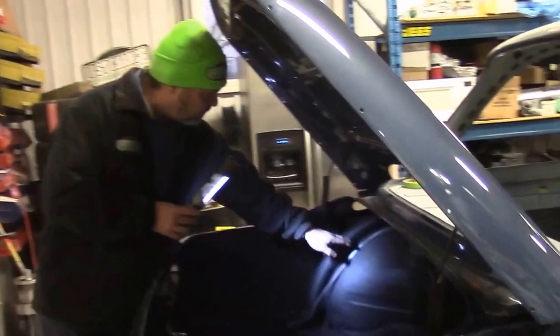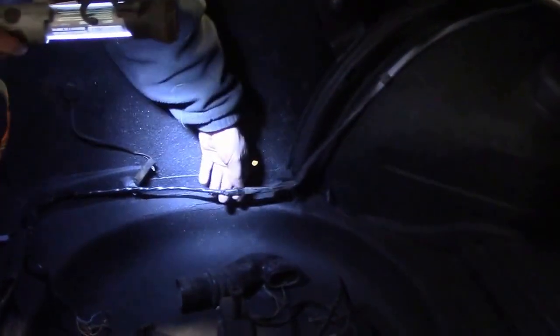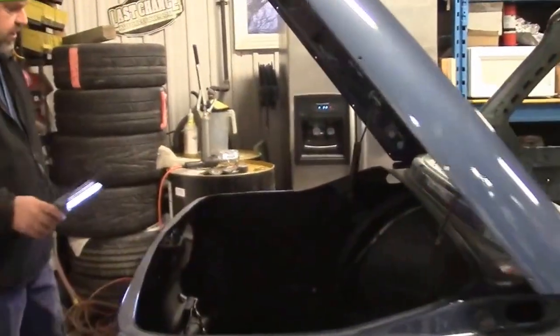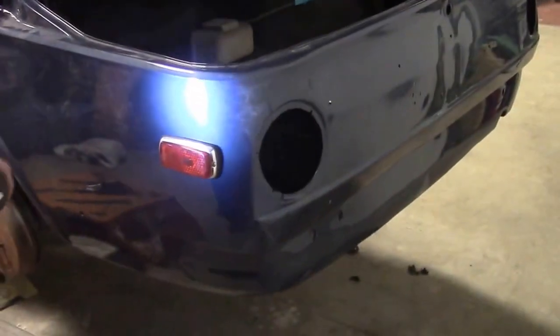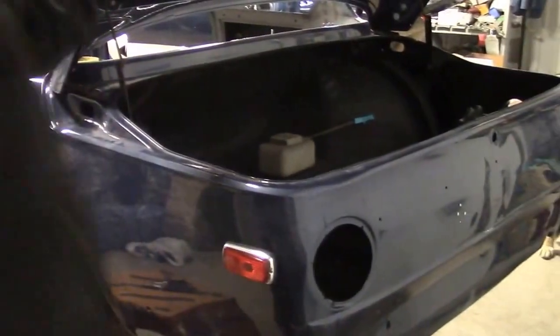You can see the wiring here — the loom has some primer overspray from previous guys playing with this car. We're going to make sure that's all cleaned properly. We're working on wiring because we had to splice in and go all the way to the tail light wiring — there were some concerns with broken wires, rusted wires, and shorts. So we're doing quite a bit of work to the wiring harness in the back. We'd like to set everything up for tail lights and signals. And you can see we've got the marker light set in on the quarter panel on the driver's side.